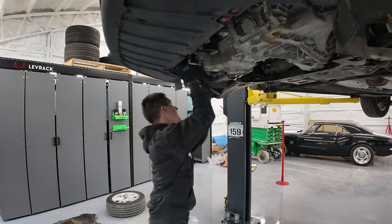So my clutch forks here came in an assembly where each one was bagged individually. So I didn't bother checking them, but I'm gonna say you probably should check. There's four numbers in the middle of this spring bolt assembly here. On this one, it's 0210. And you need to compare that to the number that's laser engraved on the clutch forks. And here it's 0210. Same, these should be the same and these should be the same. So make sure you're right on that.